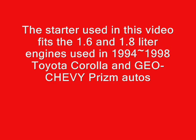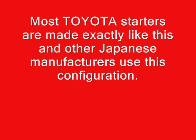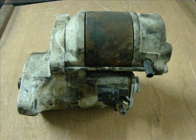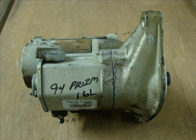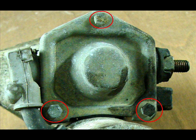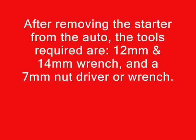If the problem you have with your Toyota is that when you're going to start the engine, it is clicking, and after several attempts at turning the key, finally the starter engages and starts the engine, and when the starter is working it sounds normal, cranking the engine at the normal speed, then chances are it's only dirty contacts, and that's why you're repeatedly turning the key to try and get it to make that connection. In this video, I will show you how to clean these contacts in case of a necessary emergency, but it's best always to change them.